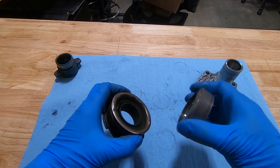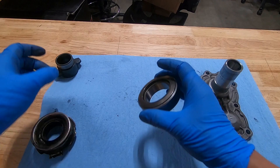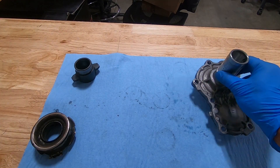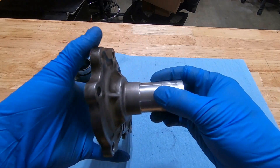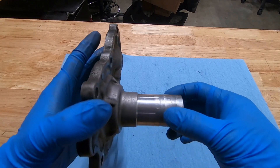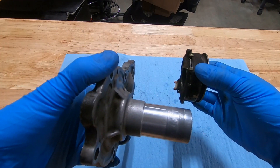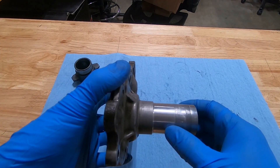The faces where they contact the clutch fingers are pretty much the same too. One last issue with the FRS throwout bearing is the actual snout itself - back in the day these used to be steel constructed, now they're aluminum, which I'm sure is for cost savings. The OEM throwout bearing actually wears grooves into this aluminum. That shallow grease trap doesn't help, which compounds the problem - when you're pressing the clutch, this bearing can get jammed up and cock on this shaft. When doing a clutch job you may discover grooves on the snout.